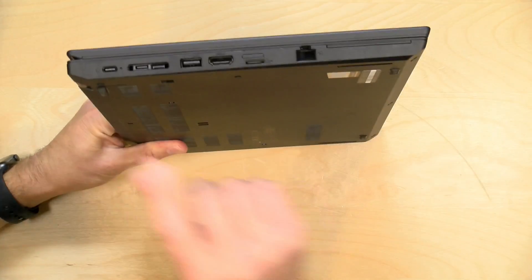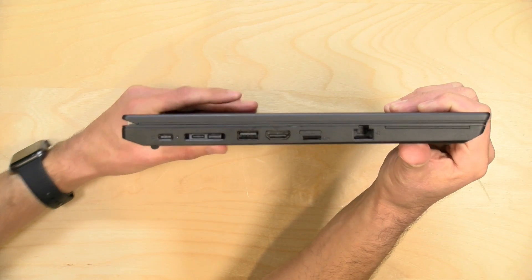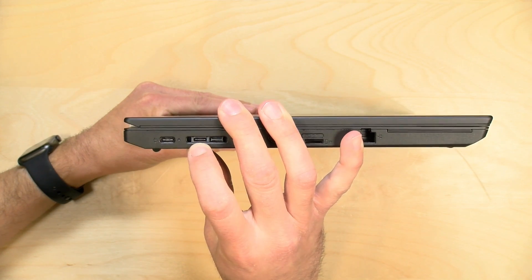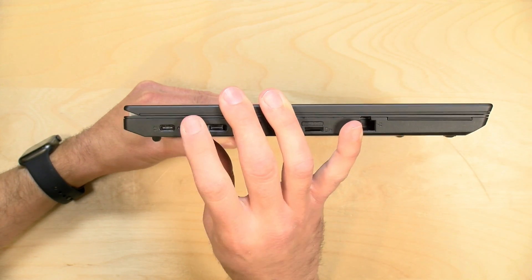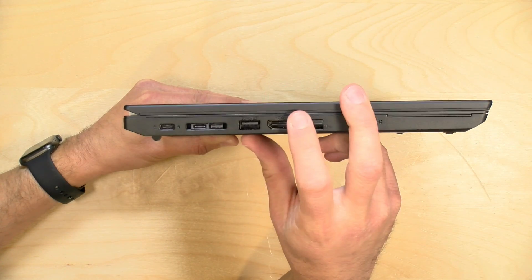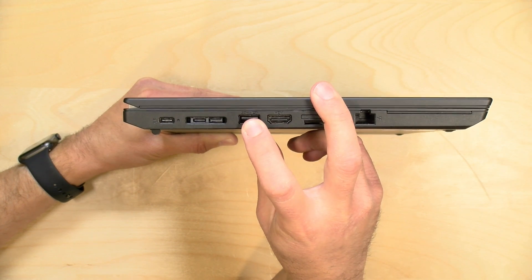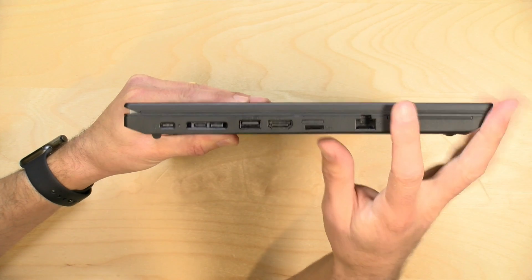There are a bunch of ports on this one. First up, there's a USB Type-C Gen 1 port — it handles data at 5 Gbps max and also takes power in and sends video out, so it's a full-service multifunction port. Next to it is another USB-C Gen 2 port that handles 10 Gbps data devices as well as power in and video out. I was surprised not to get a Thunderbolt port here, since some ThinkPad models put Thunderbolt 3 on that port, but this entry-level version has USB-C. There's also Lenovo's proprietary Ethernet adapter port for dongles or manual docking, a USB 3 port, and an HDMI output for external displays.